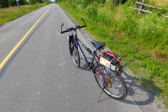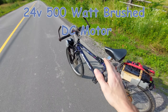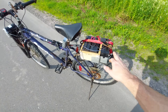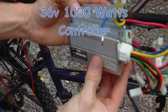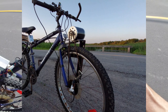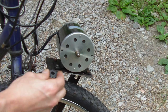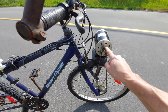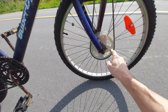What's going on guys, how's it going. I've modified the homemade front wheel drive e-bike — I've over-volted the 24-volt motor to 36 volts and I've added an extra battery. I've also removed the 410 sprocket with the bicycle chain and gears and put on the original 25h pinion, and I've put a 25h chain and a large sprocket onto the front wheel.